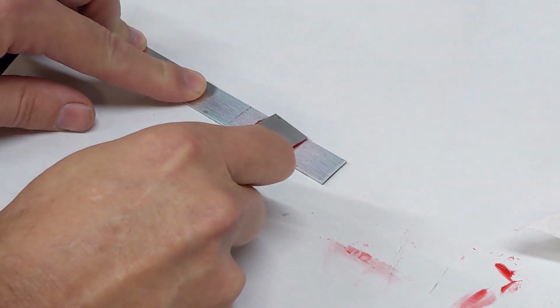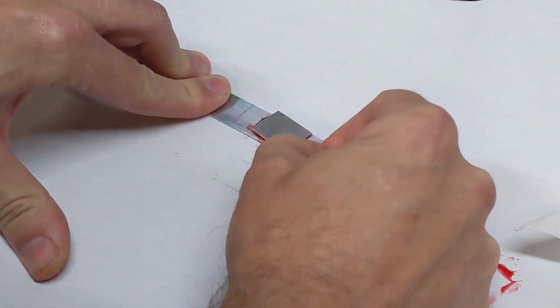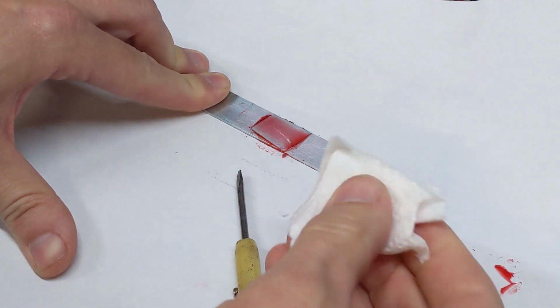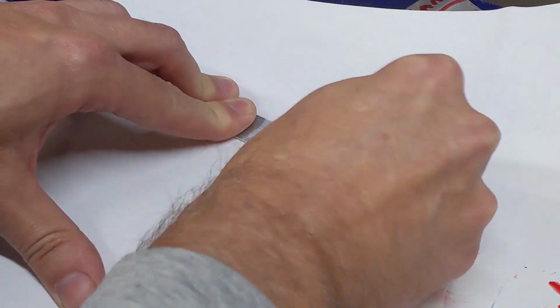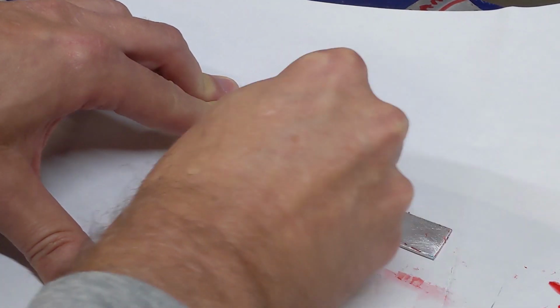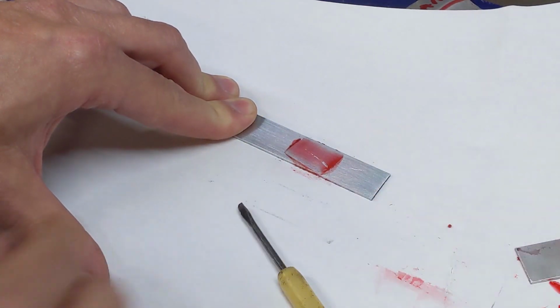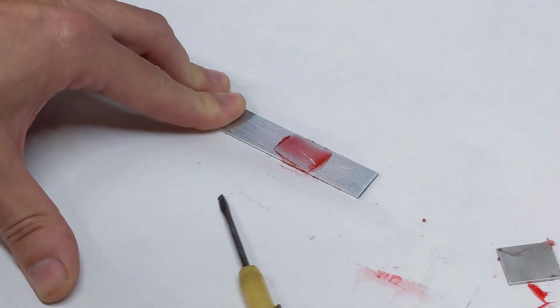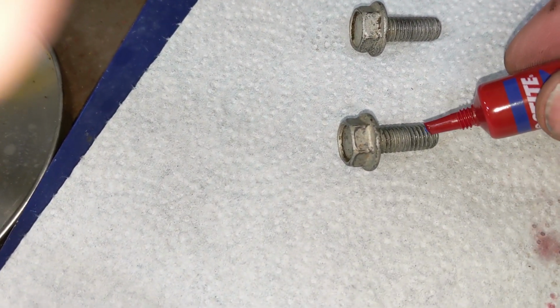if you go ahead and take a screwdriver and pry this apart to separate them, you'll find that where it was clamped together, that's why they call it anaerobic, without oxygen. So without oxygen, with the aluminum and then also the iron and copper ions or whatnot from that spray, it actually causes it to harden, and that's what gives you the seal that you're looking for. So if you're not familiar with anaerobic compound, hopefully this might save you from a little bit of high blood pressure.